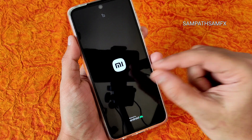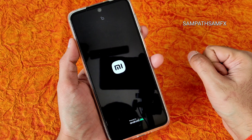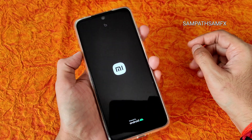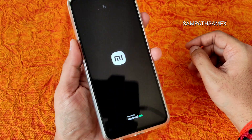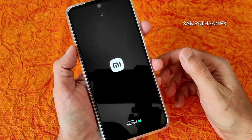If you want to root your smartphone after flashing the ROM, you can use Magisk Manager — flash that zip to enable root. If you have a vanilla build, you need to use the GApps variant. Wait for the ROM to boot — it takes more time for MIUI-based custom ROMs, so wait until it gets booted and don't keep turning the device on and off.